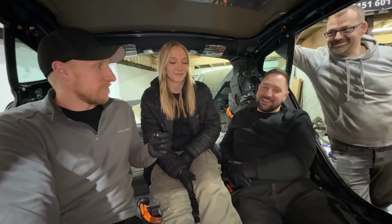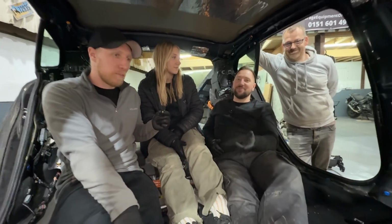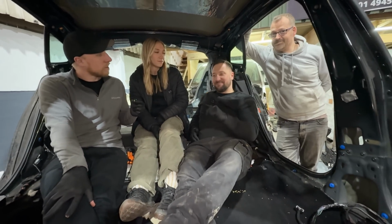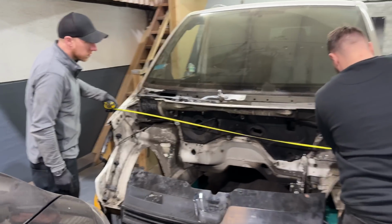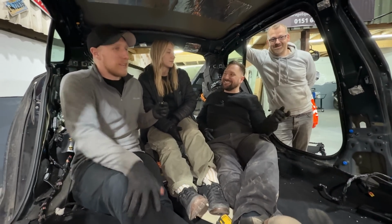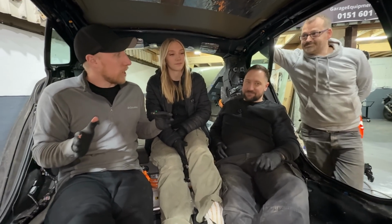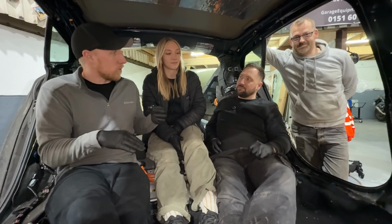How are we going to do this? This is the question, is that we always had this amazing idea that we were going to take the van and put the Tesla subframes and battery into the van. But now, having looked at it and measured and got a bit deeper into stripping this car apart, now we're unsure whether we should just be putting the van body over the Tesla, right? But it's the width. We need to try and see if we can scrub a bit of width off the Tesla to get the van body to sit over it. Maybe we can get the van to sit lower than original as well, which would look pretty cool.